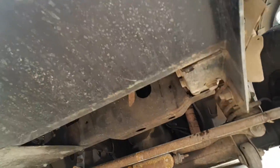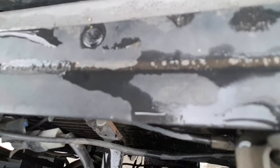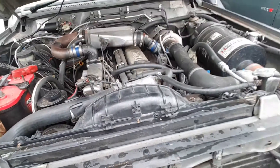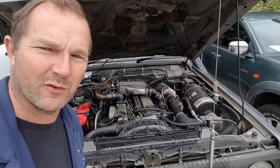Right down the bottom there's a little tiny gap. Coming around, there's no chance of getting any air through those holes, nothing underneath. Looking down behind it all, there's just no flow getting to the engine at all on this thing, so probably no wonder it's running hot.